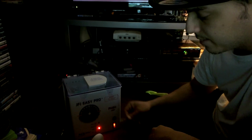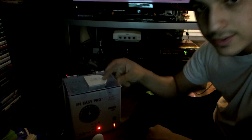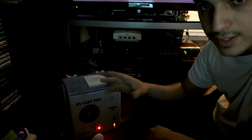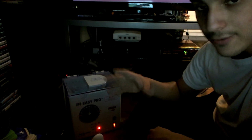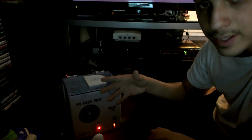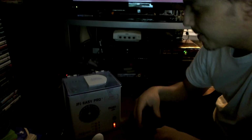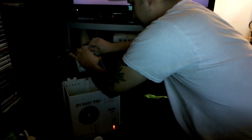So just basically, I recommend for the soft sandpaper, do 2 minutes. On the coarse sandpaper, do 1 minute, and that's only if the games are really scratched. Now, if they're just a little bit scratched, minor scratches, I just do the soft pad for a minute. That's it. And okay, so it looks like it may be finished. Let's check it out. Let me take this off.